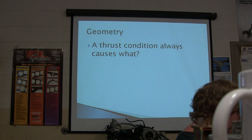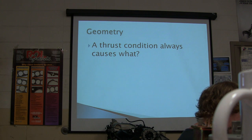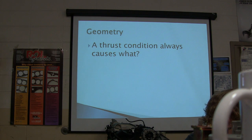Never perform a front wheel only alignment on any vehicle because it's impossible to know if the front wheels are parallel to the rears. That means don't just hang your front sensors thinking you're going to get good stuff out of that, because you need to know where they all are.